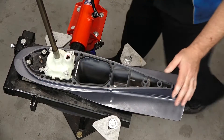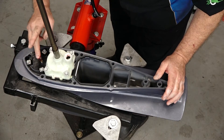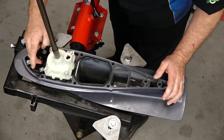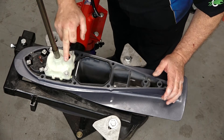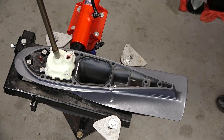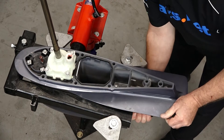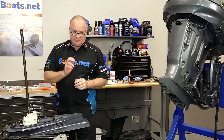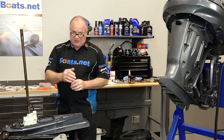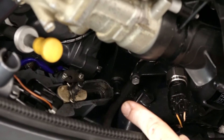Let's add a little bit of grease on the shift shaft and our water pickup or pass-through. One more thing we need to check is to make sure that we're in neutral — and we are. Now would be a good time to check the shifting mechanism up on the outboard itself to make sure it's in that neutral position as well. Yep, she's dead center.